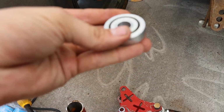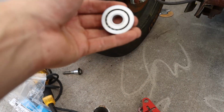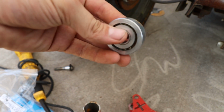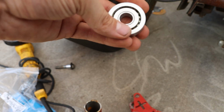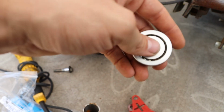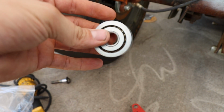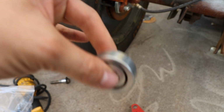These are open bearings, if it'll focus. Jesus Christ, do your thing, guy. Will it do it? There you go. Okay, so these are roller bearings. They're open, so dirt can get in them. I don't expect a whole lot to get in there, just because they're in the rear of the car and they're going to be kind of high up. So we'll see, obviously. But roller bearing setup. Gonna do a double shear style, so I'm gonna have two bearings packed up against each other.